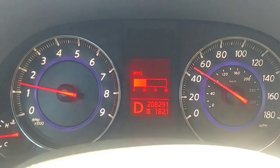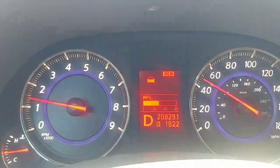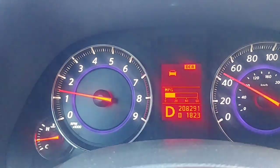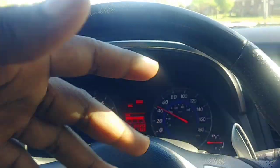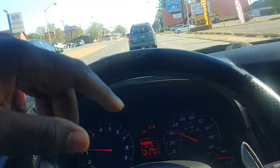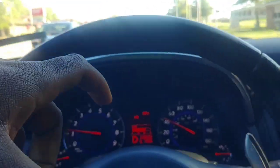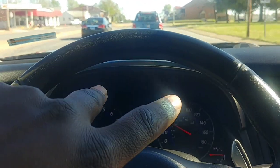The next button is DCA — distance control assist. Let me show you what happens when I hit the DCA button. One push of the button shows you a car icon of a vehicle in front of you and the letters DCA. The DCA system gives three operation indicators: a visual icon, the letters on screen, and a sensor. It's a distance control, not a speed control — it uses the sensor to determine distance between you and the car in front.